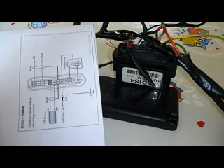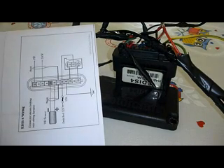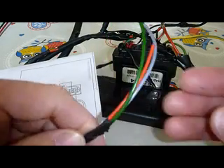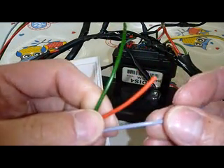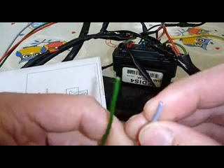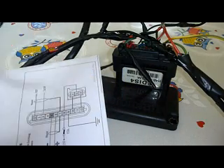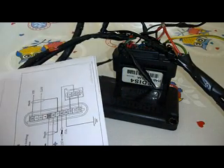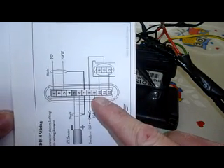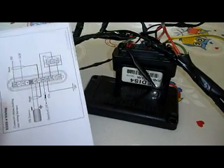For your coil pack it's very simple — it's only 3 wires. As you can see here, this is the end of it. I just have my 12V in the middle, and then I have my left and right of my coil pack — side A, side B, whatever you want to call them. Those are the wires of my coil pack, and basically it's pin 12 and pin 10 for those, and then pin 8 is a couple of different things.